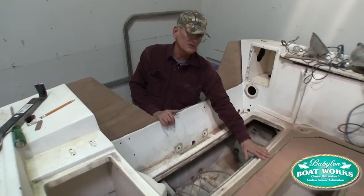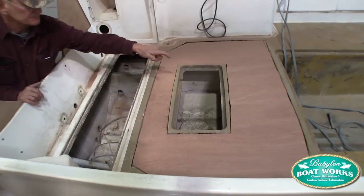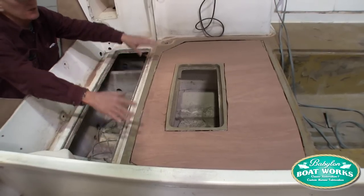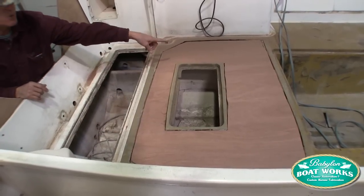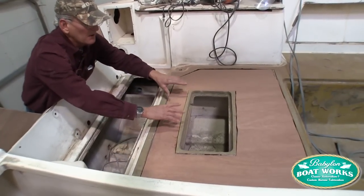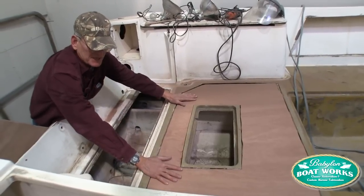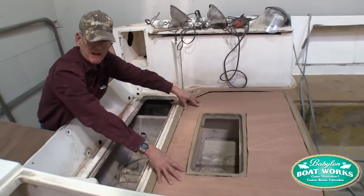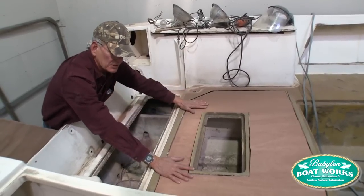In addition, we had a very soft floor back here. It had gotten cracks in it and water got in over the years and rotted the plywood inside — it was soft. So we had to cut the outer skin away, remove all the soft wood, make a template out of cardboard, trace it onto half-inch marine ply, fit it in, and scribe it.